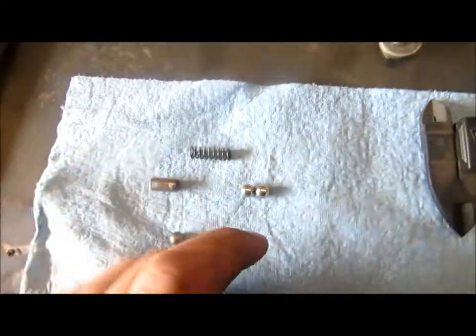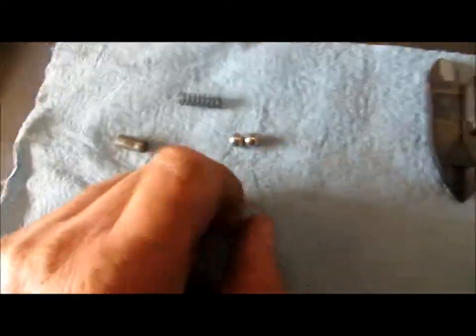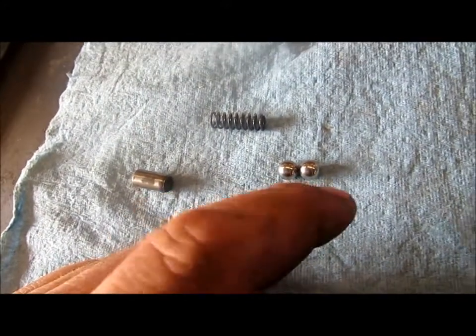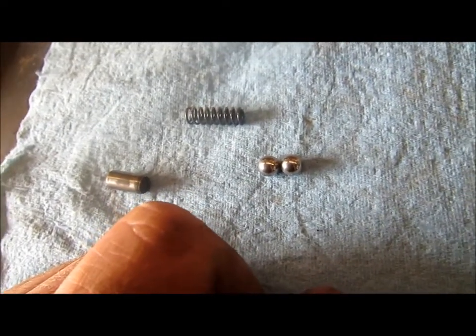My only question will be at idle. It always seems like with a ball bearing setup in place of the piston, it seems to bleed off pressure at idle. But I am told and have witnessed that there are machines out there running as little as 2 to 4 pounds of pressure at idle and surviving. The bottom end survives.